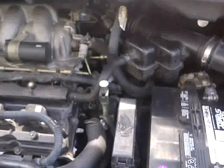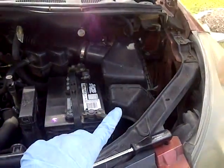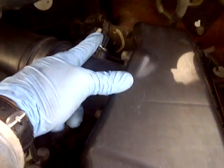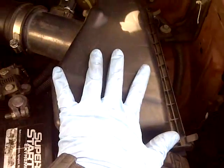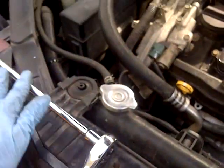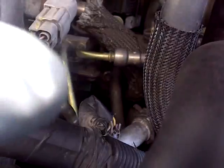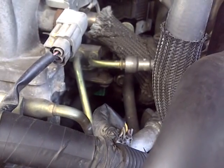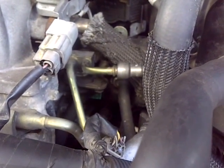Welcome back. Here's the Nissan Quest put back together for the most part. All I did was remove the air intake and unplug this connector here — that gave me room to work. Using a 10mm socket with an extension you just have to really get in there and finesse it. With the engine cold I could really get into it, and replacing the camshaft sensors is pretty easy.